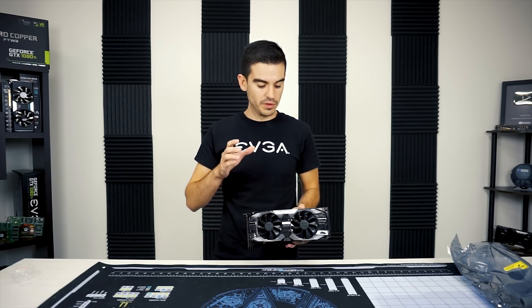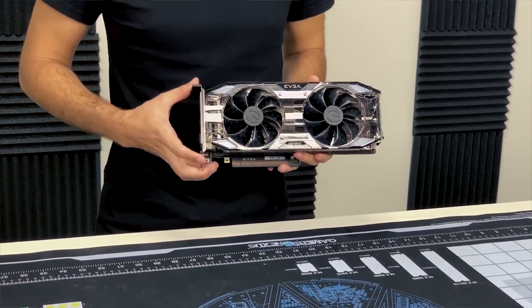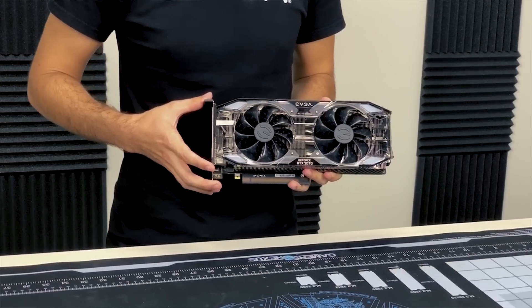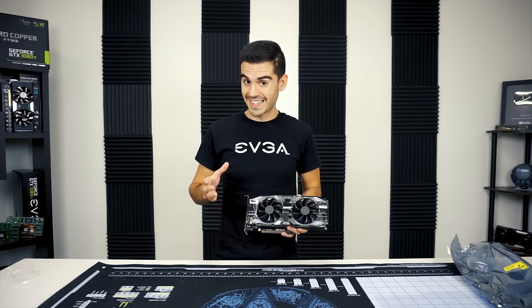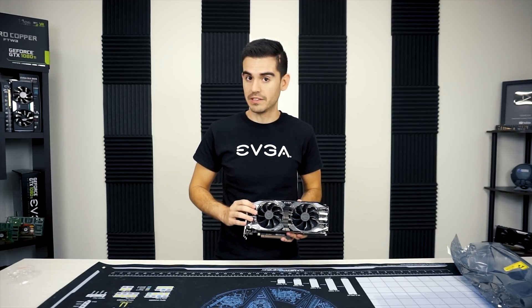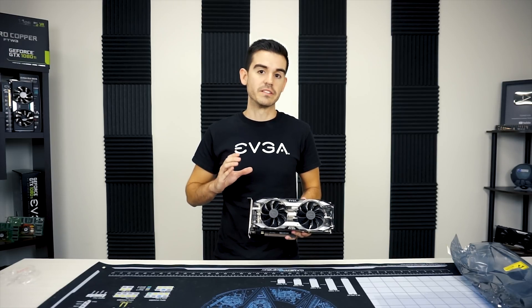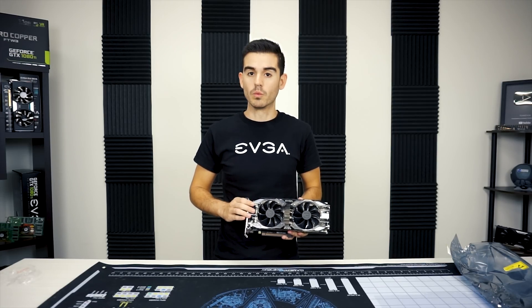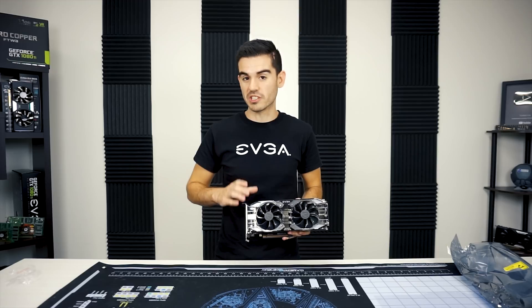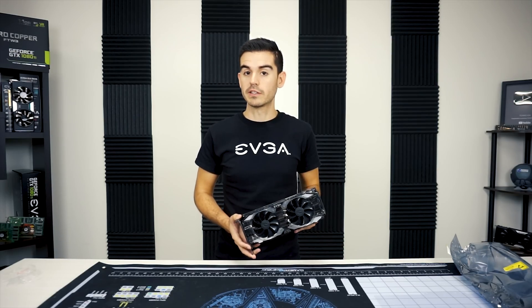Like I said, this is a bit of a little brother to the 2080. This will have 2304 CUDA cores, and it'll also have RTX cores and tensor cores in the processor. It is based off of the same GPU die as the 2080, has the same 8 gigabytes of GDDR6, running at the same bit width and speeds. So from a memory bandwidth standpoint, this is just as fast as a 2080.